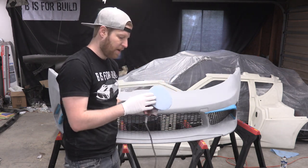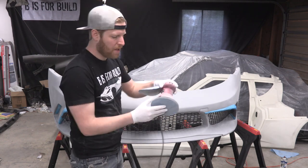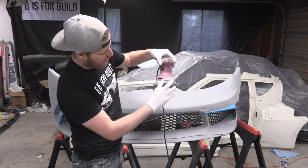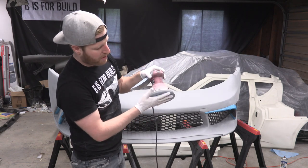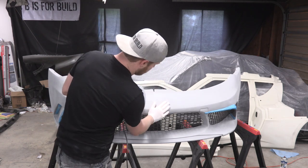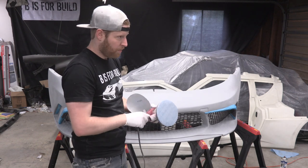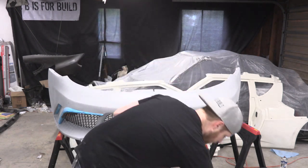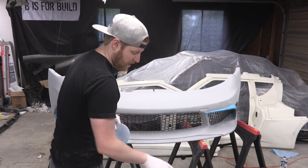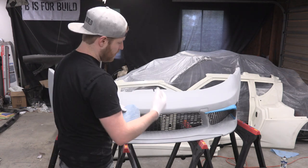I'm not that tricked out right now. But what you need to have is, I think this is called a media pad or something. So you see the sander's right here. Normally when you buy it from the store, that's where it ends. And then you have this squishy pad in the middle. These are really important. They help the sander go around bends and not dig in on hard angles. That really ruined the plan a little bit when I did that, and I had to come back and do a lot more deep sanding with that pad on there. So you need a pad in between your sanding base and your sander.